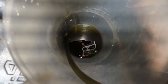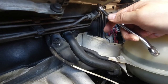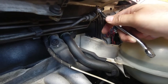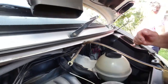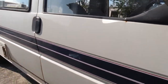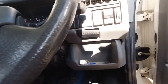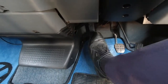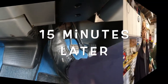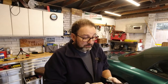There's the fluid starting to come out, and you can see the state of it - it's black. So that's absorbed some rubbish. Following what initially felt like a much better pedal, a 15-minute test drive and it was back to normal. So just bleeding the system didn't work, but I learned a few things and that led me to another conclusion.